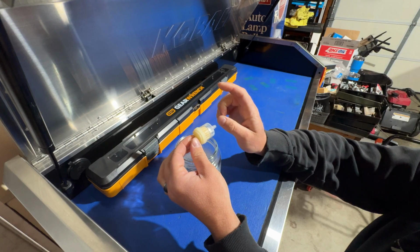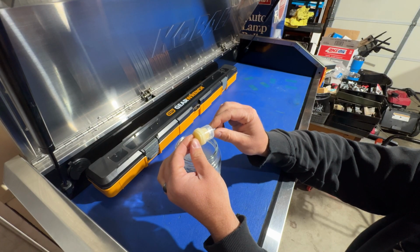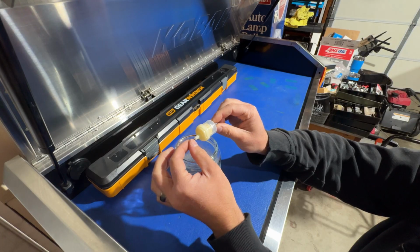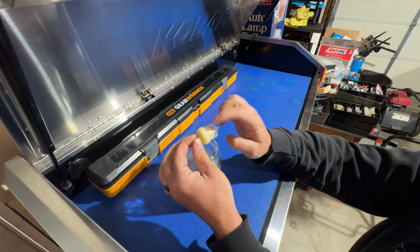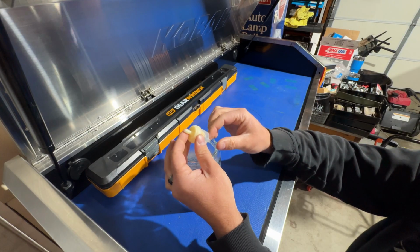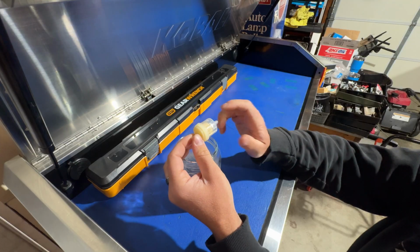So a couple things. First of all, we're going to remove the fuel filter, because when we detach the fuel line from the carburetor, it just slowly drains. Like it's hardly even a drip that's coming out of it. So there's some kind of restriction somewhere. Don't know if it's the fuel filter or if it's further up in the tank. But if they didn't have one from the factory, we're not going to put one back on it, and we're also going to check for any hindrance in the line further up.